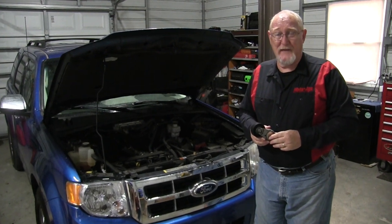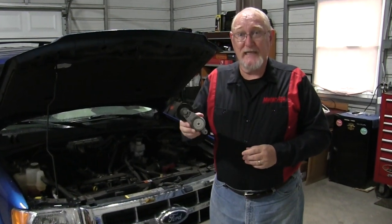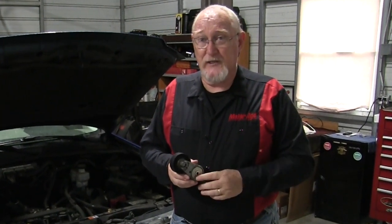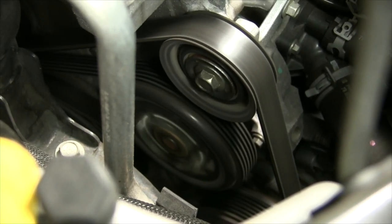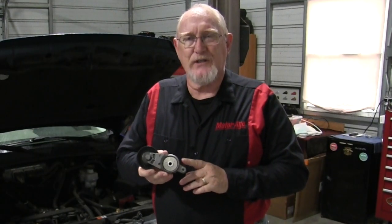The belt is not the only wear item in the system. Commonly overlooked is the belt tensioner. Most manufacturers recommend that you replace the tensioner whenever you replace the serpentine belt. Many of the manufacturers offer kits — just as our sponsor ENA does — to make it that much easier to do so. But maybe the belt was replaced and the tensioner wasn't. It's not a bad idea to perform a visual inspection on the tensioner with the engine running, just to make sure. The two most common areas of wear in the belt tensioner are in the damper assembly or in the pivot bushing.